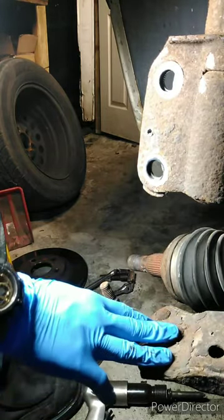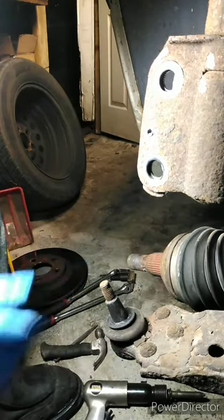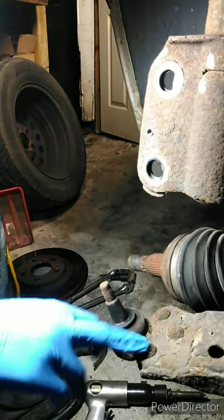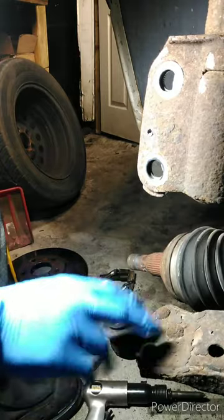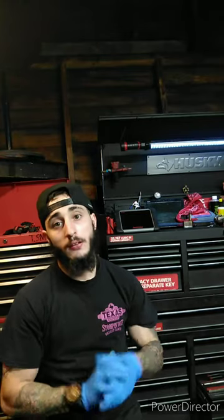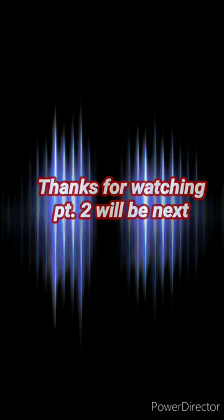I did the other side and we're going to do this side. Then basically we're ready to put it all back together and I'll show you guys that on the next video. You chisel these off and then use a hole punch to punch them through — that's probably the hardest part of the whole job. So we just did the teardown on how to do a stabilizer bar, ball joints, tie rod ends, and stab links. Tomorrow I'm going to show you guys how to put it all back together. Hopefully you guys learned something — thanks for watching and have a good rest of your evening.